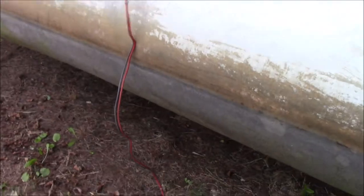These two right here go to the front, and then those wire in series and come back here. They wire together, and then they have one feed that comes back here and ties into your hot right there. We want to put these on two separate switches, so we can turn on the bimini one if we want to, or the front ones if we want to. And that's just going to be our power feed. I don't know if we're doing a radio in this boat yet.